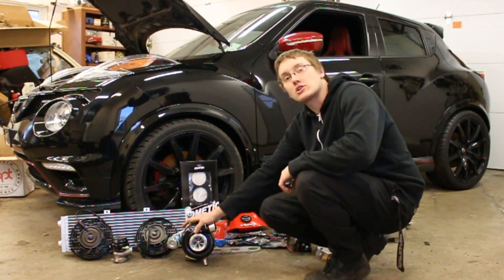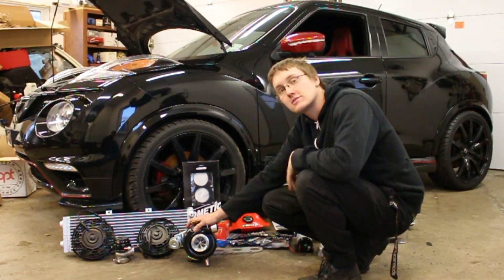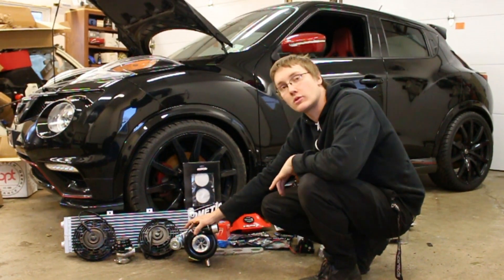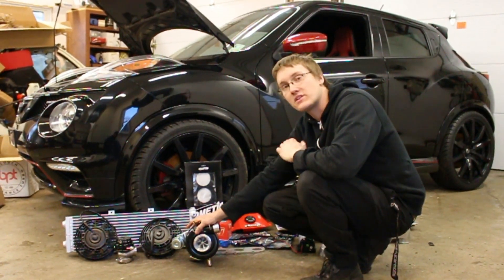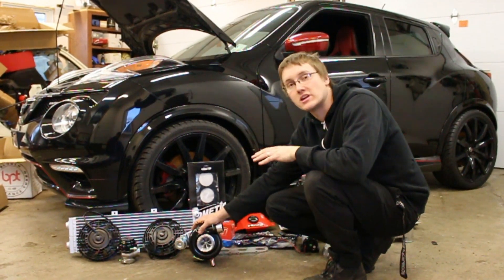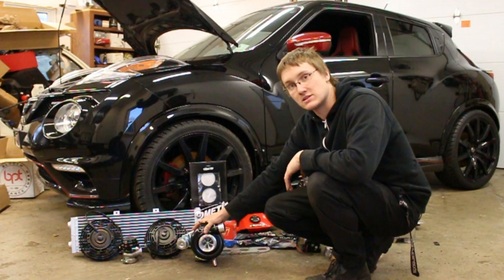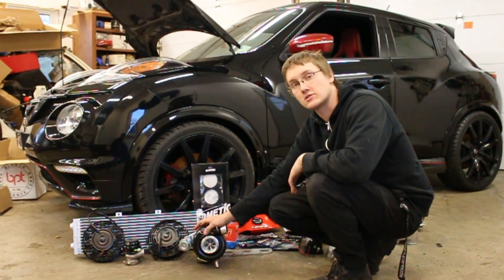We're running a Flausch 18G TD05 Subaru turbo — yes, a Subaru turbo again. The last Juke with one of these was running a 16G and did 331 horsepower no problem. With meth injection that probably could have gotten up to about 380. So this bigger turbo combined with the meth injection should get us to where we want to be.